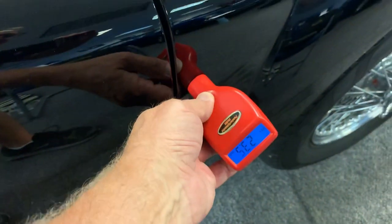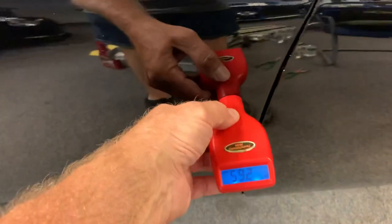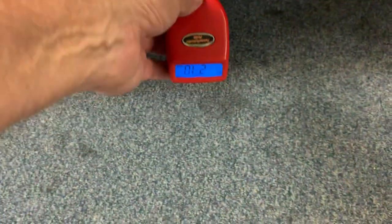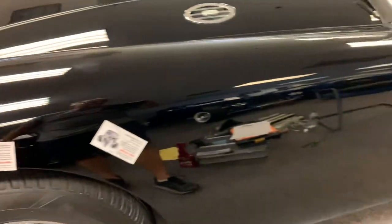So my meter reads from 31 down, and we're getting readings mostly in the high teens and 20s, but the readings up high, 9.5, readings at midpoint, 21, and down low, 11. So the bottom structure is really good, nice and clean. The thickness, 11 represents the thickness of about $4 or $5 bills of surface on top of the metal.